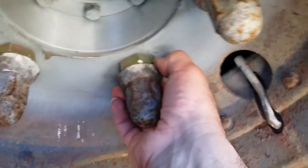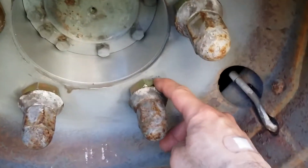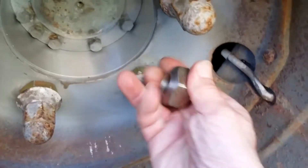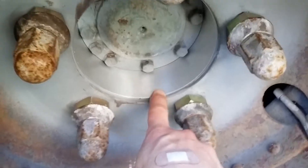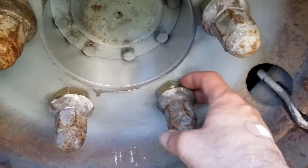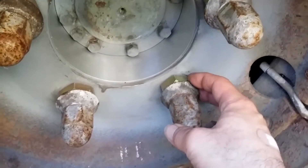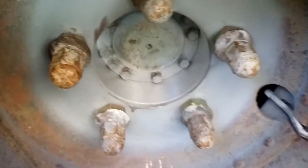I've used the larger nuts to help center the wheel, because I think it's a 22mm hole on the actual wheel itself. These will help to centralise the wheel, because it's got nothing else as a reference to center it against. So I have to use this taper — these lock into the hole of the stud, and then I just use the standard nuts on top to lock it all up.